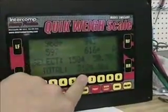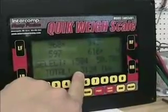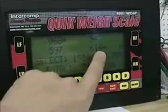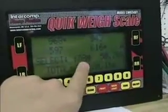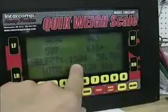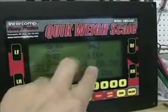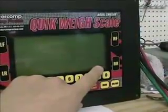What you've got here is your total weight, which is about how the car weighs wet. This is the select total, and I have the right rear and the left front selected, so that is the total of those two. Over here on the side, this is the percentage of what we have selected of the total weight. I've got a little battery there, but anyway, the percentage is what we really care about.